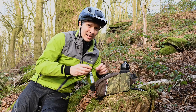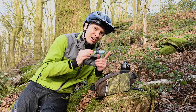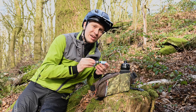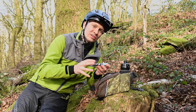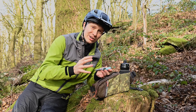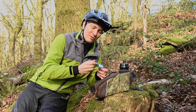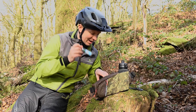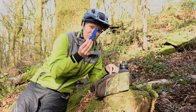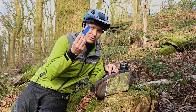To get the air back into your tyre, it's worth taking a carbon dioxide cartridge — ideally a high volume one, so like a 16g or 20g item like this, because any smaller and you're unlikely to get enough air in your tyre, especially if you're running high volume tyres or a 29er. You'll also need the little tubeless inflator bit, and whatever you do, don't just lob it in the bushes once you're done with it — take it home. I also throw in some tyre levers, because they weigh basically nothing, and if you do need to wrestle a tube off, you've got them.